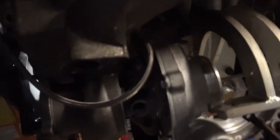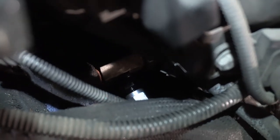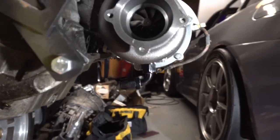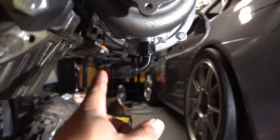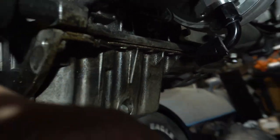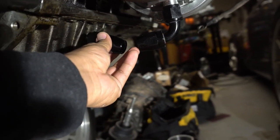I think this is where I'm going to route the oil line — coming from the turbo, going through the back, and then through here. That is where the oil line attaches. I do need to modify that adapter because it doesn't clock in the right position — there are a couple of lines that get in the way of the oil feed. Moving on to the return line: I have the turbo clocked at around the 6 o'clock position with a 90-degree fitting coming off the turbo. I need to put an oil return bung right about there.